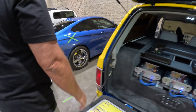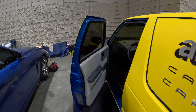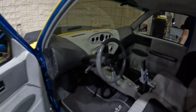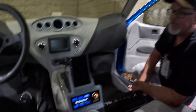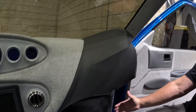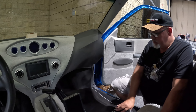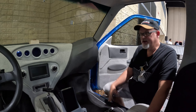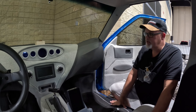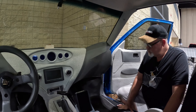If we come around to the front — go on the passenger side, I'll sit in the driver. In the front, basically it's a three-way tower on each side of the dash. Behind the grills here you've got the tweeter, the mid-range, and the mid-bass. Mid-bass is in the kick panel area. And it's basically a two-channel stereo, minimalist audiophile presentation. I'm not running rear fill, not running center channels — doing everything with real two-channel audio.